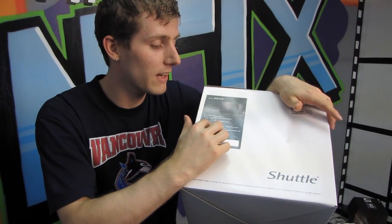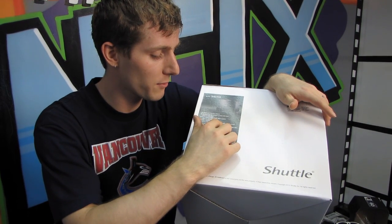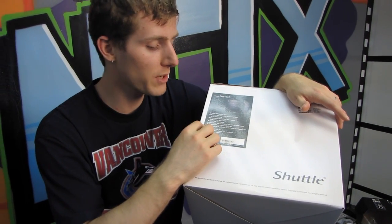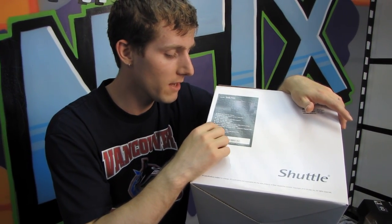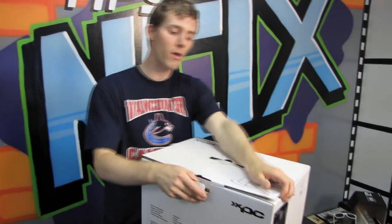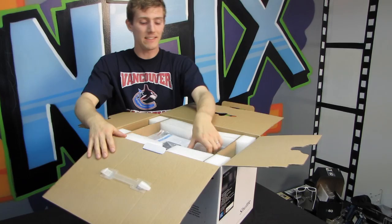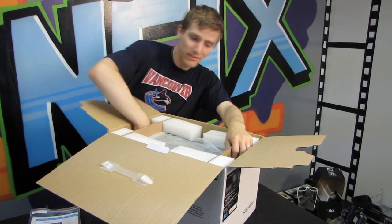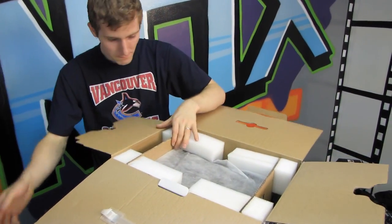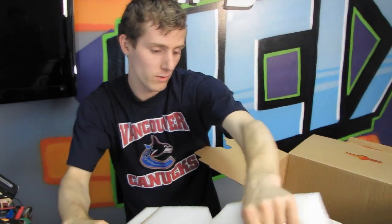All right, one PCIe 16X slot, so you can build a pretty decent gaming machine in this. Support for USB 3 and SATA 3 6 gigabit per second, as well as 7.1 high definition audio. Expansion capabilities: two 3.5-inch hard drive bays, one 5.25-inch bay, 80 plus 300 watt power supply, so that's going to be enough for pretty much whatever you'd want to add to it. Remember, this is a smaller motherboard. There's not a lot of room for expansion. A 300 watt power supply is going to easily deal with that CPU, and pretty decent components in terms of RAM and expansion cards, as well as a decent video card.